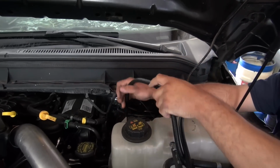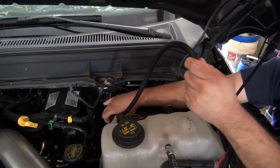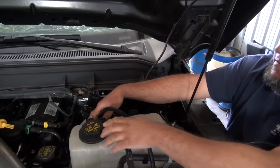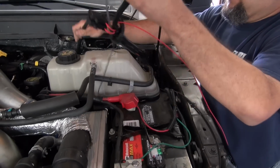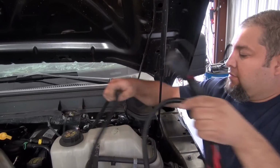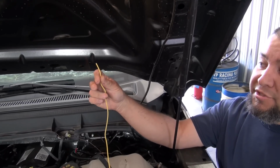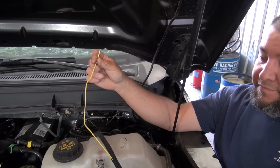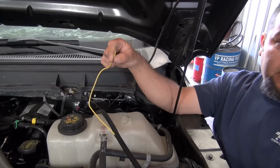These engine compartments don't quite have the room they used to have. Hey, pull it back and show them the yellow wire. This yellow wire right here is what gets hooked up, color coded on the instructions we send you, to the actual sending unit of the stock truck. Okay, so that's where you cut into that wire loom on the frame. Yes, that's where you cut into the wire loom, and this actually gets put on through a T connector and a male spade that'll go through there.